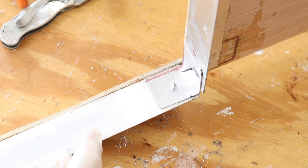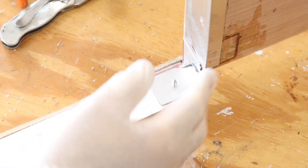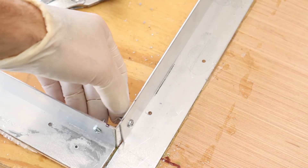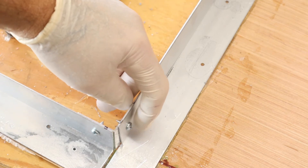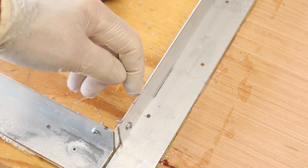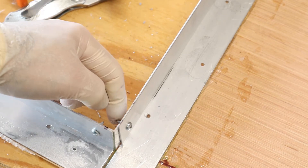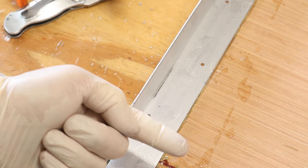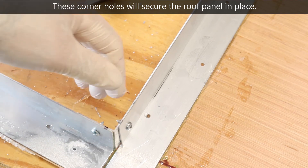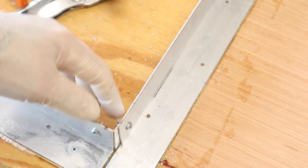You can see that piece of aluminum right here — it's the same aluminum, just a smaller piece that I cut. I screwed it in here to see if this would fit up in the hole in the van. But the fit is so tight that the screw heads themselves — on this side and the other side — are enough thickness that it doesn't fit. I could probably push it in but have a difficult time getting it out. So I'm confident that once I epoxy this up and remove the screws, it'll fit really well. I expect to use these screw holes when I install it to actually put a screw in sideways to hold this all together, so there's a reason for those holes beyond just holding it while the epoxy is bonding. And hopefully I can get those screws out after it's done — if not, I'll just have to grind them off, and that's okay too.